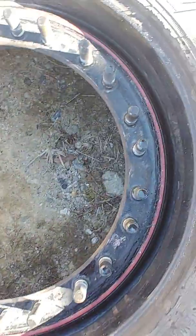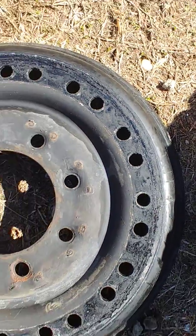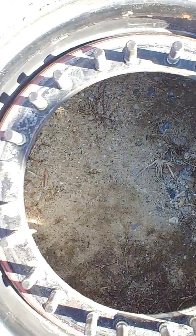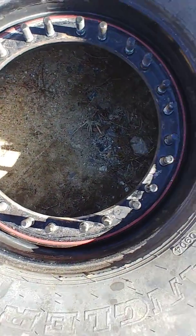Here's your o-ring sitting in there. This o-ring is pretty filthy - we may have gotten a lot of crap on it when we put the wheel back together originally because we were trying to get done fast. This side of the rim is just flat so it might be a bit scuffed up too. It might just be a matter of pulling the o-ring out, cleaning it, and putting it back in - but seeing as we have this apart, we may just put a new o-ring in, because it is a pain and time-consuming to pull this all apart and torque 24 bolts twice.